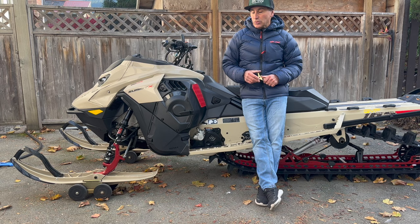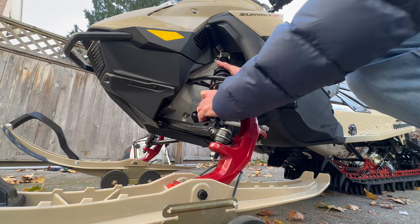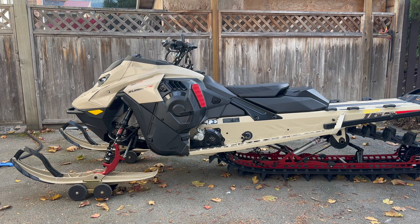So I've already set the front here just by turning the coil and this piece up here to one. Then on the back we're going to go down to the backside here where there's an adjustment — one on each side — with one through five settings. I'm just going to set these using my tool to one on both sides.